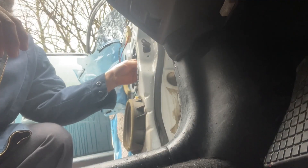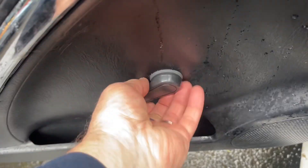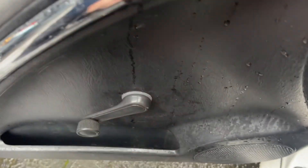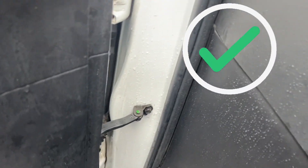You have a little speaker cover here — again, use a body panel tool on that. Once you have it loose from the bottom, it simply goes in the hole like that. Then you just put the clip in place and it pops in automatically. There you go — drove that in and there it is, all set.